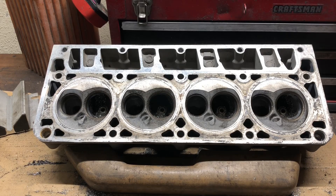Alright guys, I pulled all the valves out and kept them in order - hopefully you guys are doing the same. What I wanted to do was point out that generally I like to either start on raising the roof on the exhaust side, or more commonly I'll start with my bowl cut percentages and get them knocked out, because sometimes they can be kind of slow and tedious.